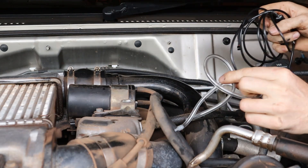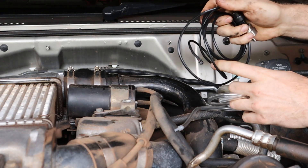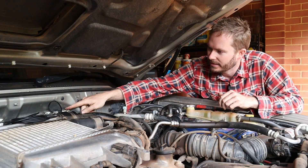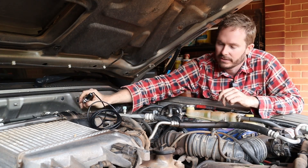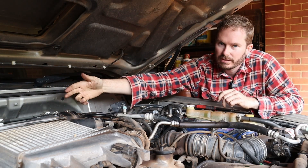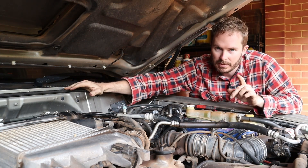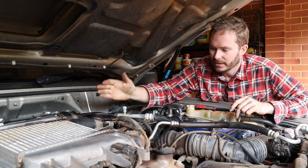This is a small length of clear hose that comes with the boost gauge — nice tight fit. I'm not going to cut it to length yet because I want to make sure there's enough cable. I'll run it over to the sensor and mount it up against the firewall. Once the sender is in place with the wire ready to go into the cab, I'll cable tie everything up and use conduit to protect the cable. Rather than pulling the boost wire through the firewall on its own, I'll wait and run it together with the EGT gauge wires at the same time.